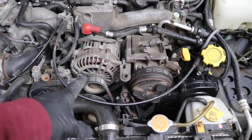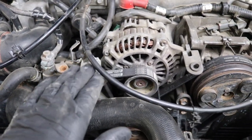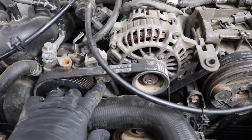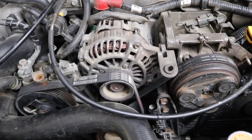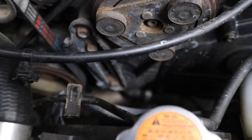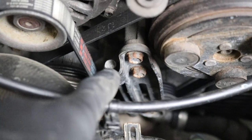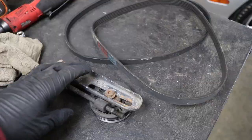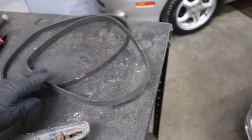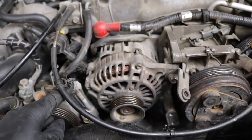We'll do the alternator and power steering belt first because it's in front of the AC belt. You've got one 12 mil bolt for the tensioner adjuster. Loosen the bottom bolt, then loosen the top bolt which drops the alternator so you can pull the belt right off. For the AC belt there's one 12 mil bolt on the idler pulley — loosen that to release tension and pull the belt off, then pull the two 12 mils for the idler pulley bracket. Note: on the alternator you also have to loosen the mount bolt on the side before you can lower it.